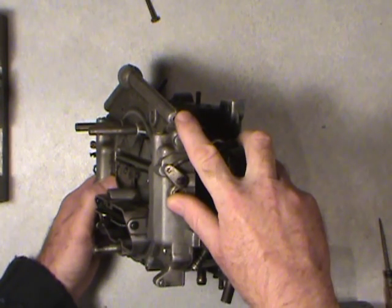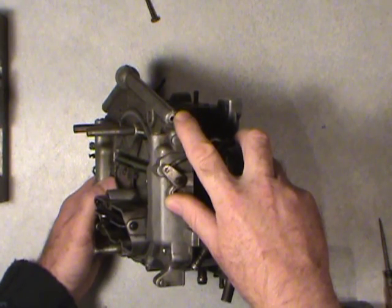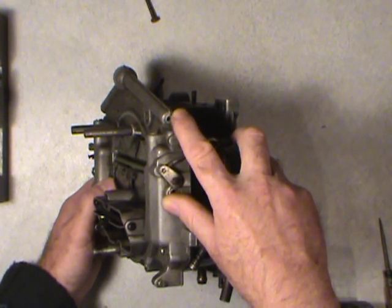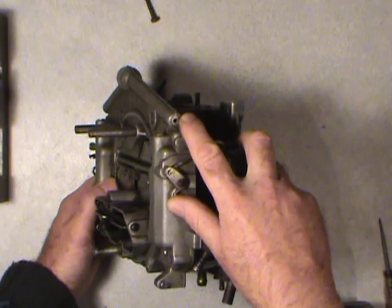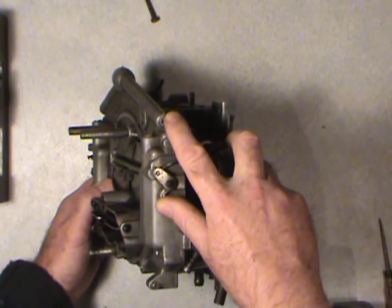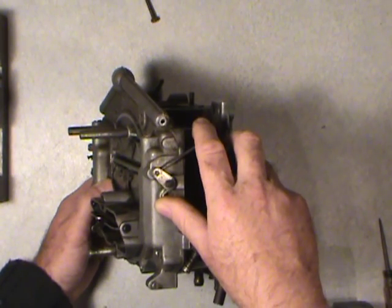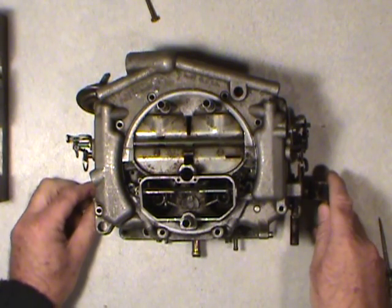So if you want to really get in there and clean it out, blow it out with compressed air if you have it, and make sure you're wearing safety glasses. Or if you don't have a compressor, you can go to a computer store or somewhere like that, and they have cans of compressed air. You don't want to be spraying anything volatile, but air is pretty safe. A can of compressed air usually has a spritzer tube for cleaning keyboards. You can get in there and blast it out with that. But with anything that just uses plain air, protect your eyes and the people around you.